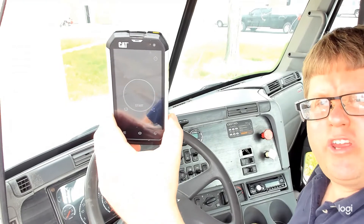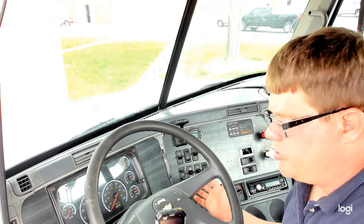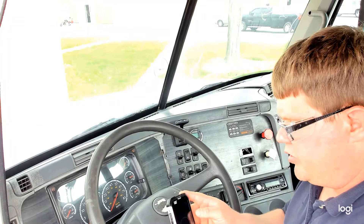We reached governor cutout at basically four minutes, five — seven seconds till I hit the timer. This is within specs, but it did take a relatively long time to build up air. This would pass, but there could certainly be these air leaks causing part of the problem with buildup. You want to make sure it doesn't exceed five minutes. Otherwise, that is a concern.